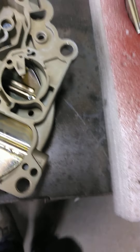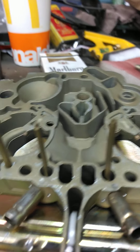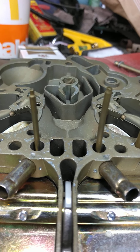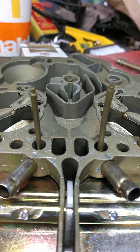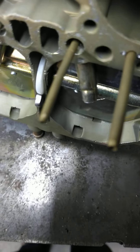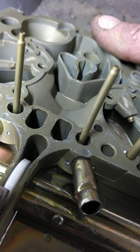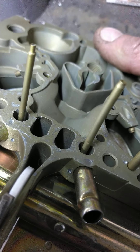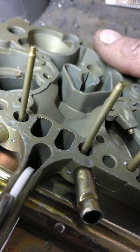I'm three-eighths of an inch down from the wall. I'm going to raise that three-sixteenths, maybe a quarter even — raise it up some more. That'll give me more available gas on demand in the carburetor. And then I got a look at this, and this is the kicker. The two center tubes are your draft tubes. Look at the one on the left, look at the one on the right — they're not even the same tubes. The one on the right is bent. Look at how bad it's bent compared to the one on the left.